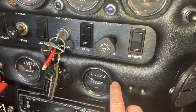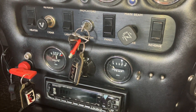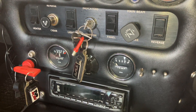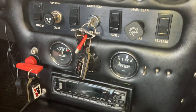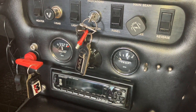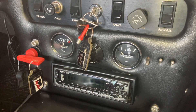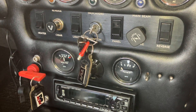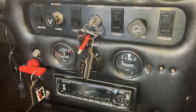What we need to do now is turn on the fuel pump — you can probably hear it coming on and pressurising up. The fuel pump is rear-mounted on top of the space frame but below the GRP of the body shell, and it's sound insulated, though you can still hear it while it's aerating. It's a Facet Red Top pump so it's got more than enough capacity for the single Weber 32-36 DGV carburettor. The reason I've got that pump is this car also runs twin Dellorto 45 DHLAs and Weber 40 DCOEs, but they're not currently fitted.